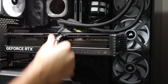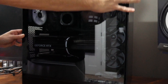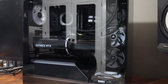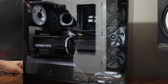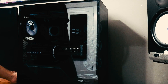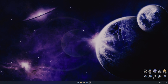Keep it straight and make it look good. Then we're going to put the glass panel back on — take the thumb screws from the top and bottom and screw those in. Once that's screwed back in, get everything in place, put the computer back in its spot, get all the cables plugged back in, and then we're going to flip the power switch on the PSU. We got lights on the motherboard — power it on and we're good to go.